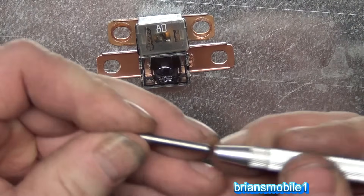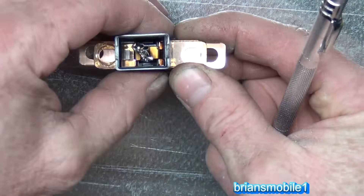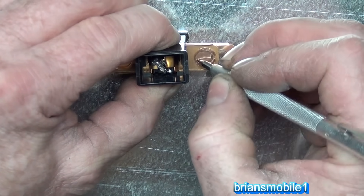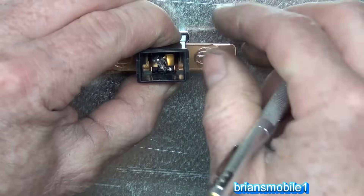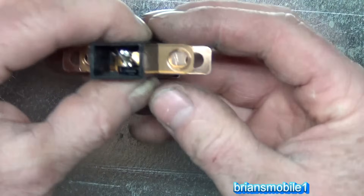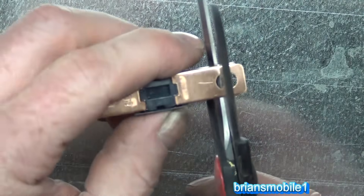What I do is get a tungsten awl — it'll scratch. I'll turn this one upside down. You can get rid of the cap at this point since we know it's 80 amps. Line the two up and scratch from the side you want to the side you need to trim. The nice thing about this new one is that it's the wrong size in an advantageous way — you can cut stuff off and be alright. We're going to scratch in where we need to drill. I'm going to drill a hole here for the screws, but the height, box size, and amperage are what we need. I'll trim the rest and we'll be in good shape. You can see I'm going to drill here and here, and cut it off here and here — you could probably even use scissors, this stuff's not that hardy.